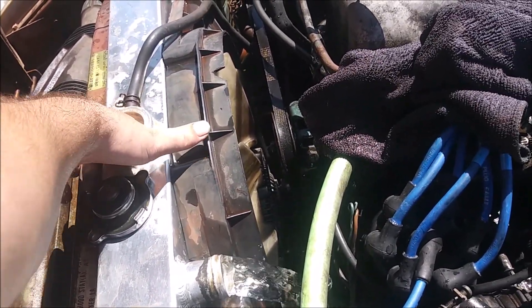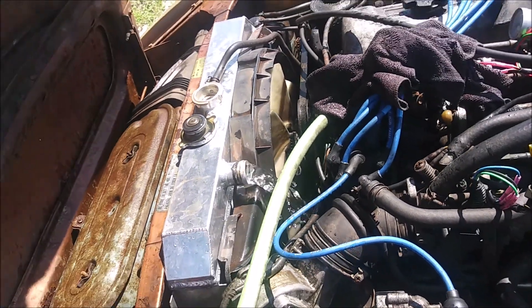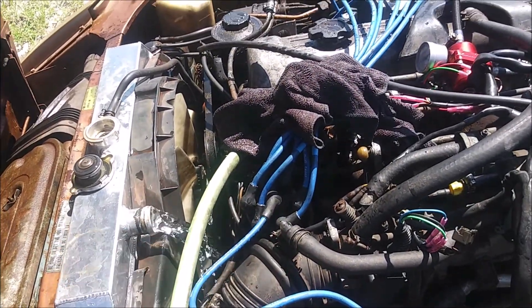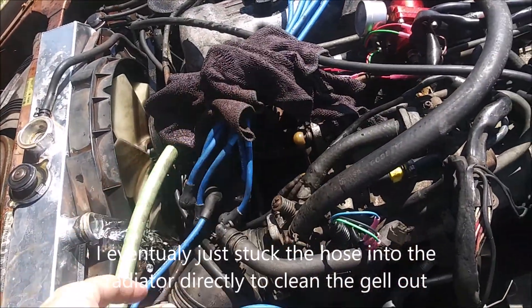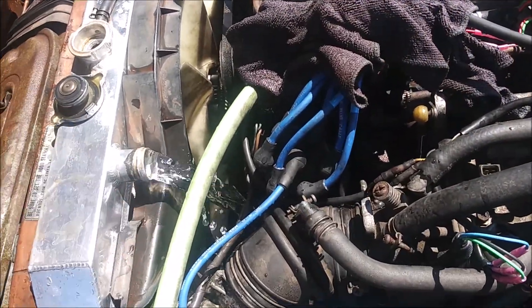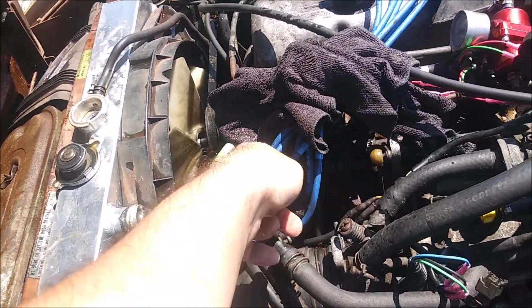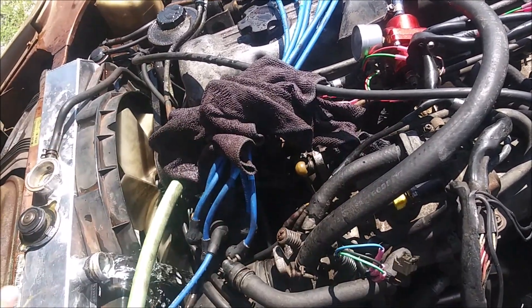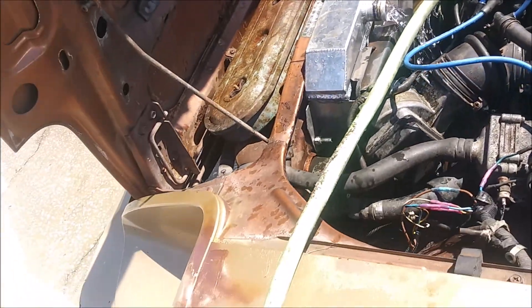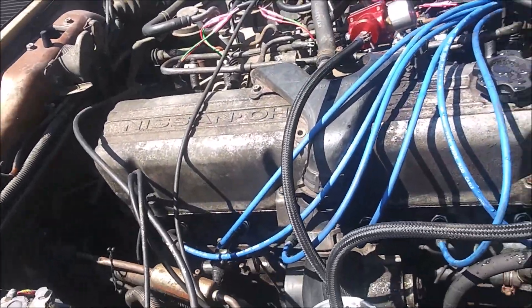Sticking my hand in — I'm not feeling much of the gel stuff anymore, though I do see some in there still, so there's definitely some residue. The water is flowing backwards from normal — normally it comes out of the top of the engine, down to the bottom, and back in. I could put the cap back on and shove the hose in to let the water pump circulate it, but I don't want to do that.